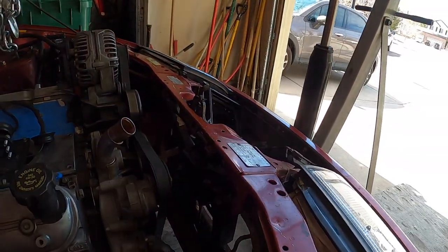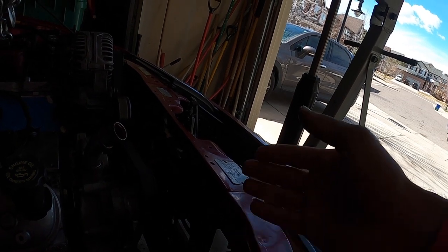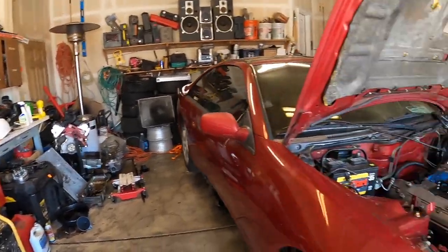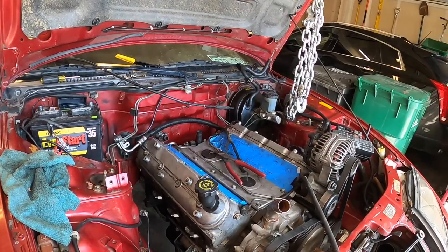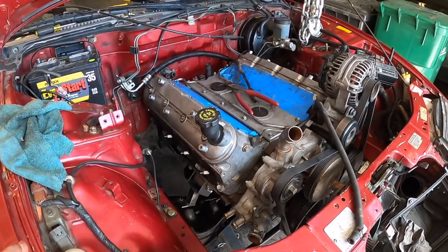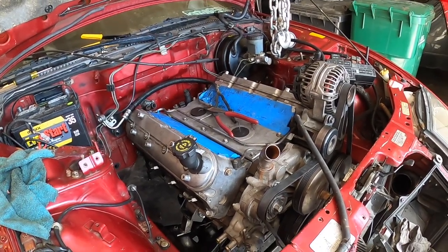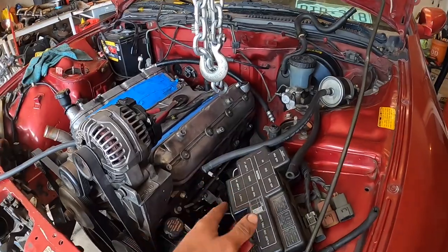The radiator might be a little difficult but we're going to figure out some way — probably run it just like an F-body Camaro, slanted forward from down below and mounted up top. For now I'm going to reuse the exhaust I had made for the GMW just to see if I can get this thing running. I'm going to run the truck intake temporarily — no hood — just to get the car started. Once it starts up we'll work on getting an LS1 intake. This whole setup is going to work really well; I have so much more space on both sides.